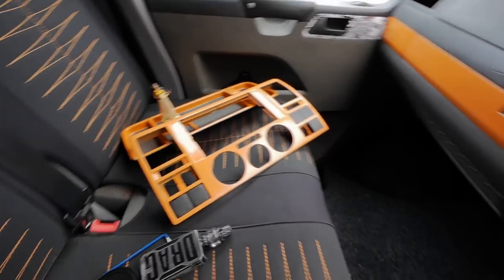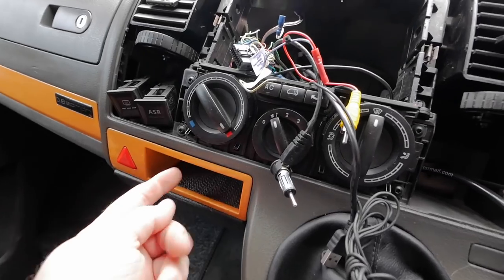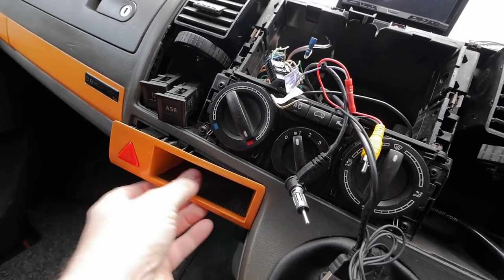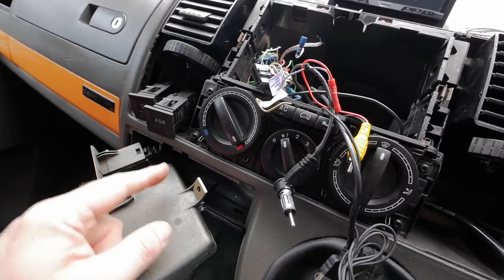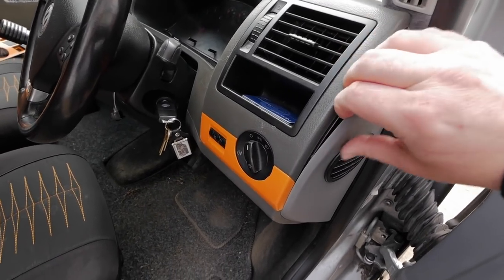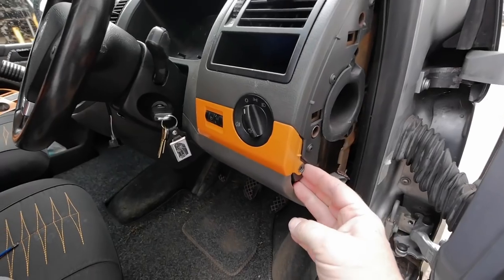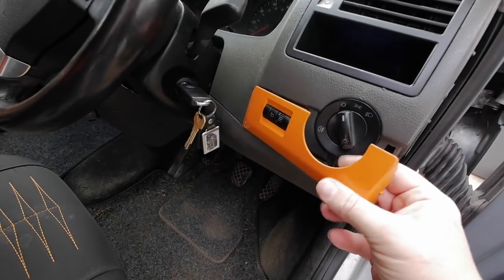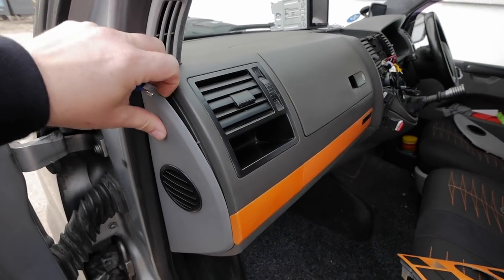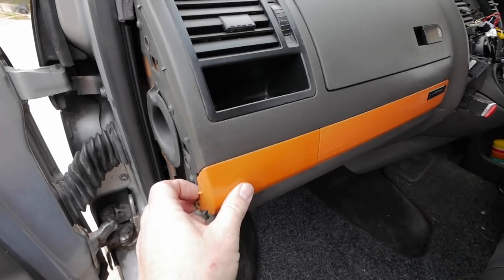I've just got to unclip those switches — I need two hands for that. Right, there's another one off. This one here, round the back down there, there's a T20 Torx bit. Undo that and it comes out. I've already broken mine because I didn't realise it had that on at the beginning, so mine just pulls out — but remember yours, it goes in there on the back. This side, pull this end cap off. It just clips off and down there there's a T20 Torx bit. Take that out and it just unclips. Same again on the other side — pop this little trim off, there's a T20 Torx bit down there, once that's out just pop it off the same.